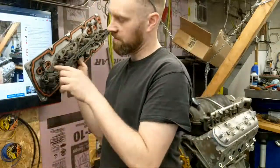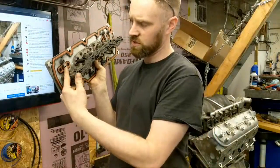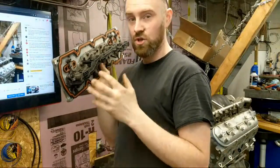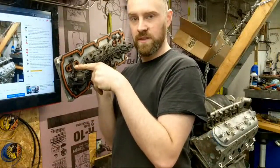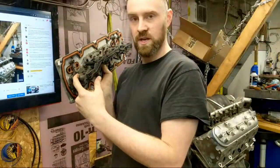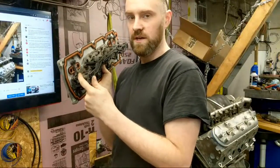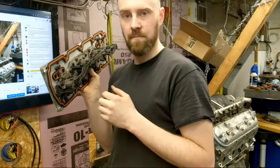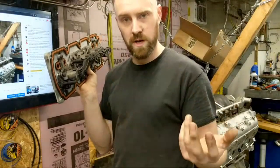So here's the VLOM, right? And those tower holes feed this, and it's supposed to bleed out here and then bleed past here. I'm wondering if it's not so incredibly dirty that it's plugged the little screen that's in this, and there's also a screen before this, and I'm wondering if it's plugged both those screens to the point that it's actually causing it to lock up or collapse the lifter, because it's seeing oil pressure there, which is what activates these